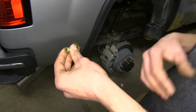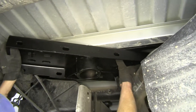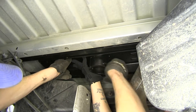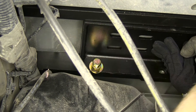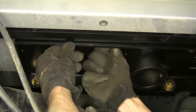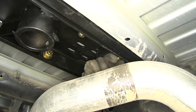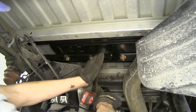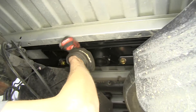Now we'll get our remaining eight bolts together with the lock washer and the flat washer, and grab an extra set of hands to raise our center section up into position. We'll raise it up over our exhaust and around our brake lines. Have our second set of hands hold it up in place while we install our hardware. You'll want to make sure the ball section faces towards the back of the truck when you raise it up. Now that we have two bolts started on the front side and two on the back side, we'll install the other two in each rail. Once our gooseneck center section is in place, we want to make sure it's centered in the bed of our truck.